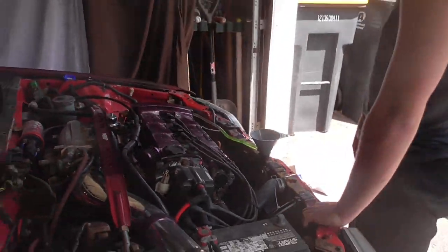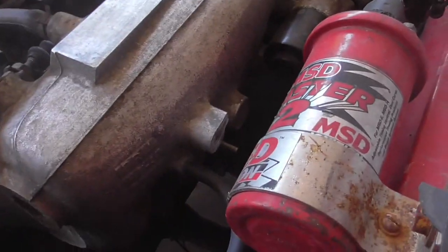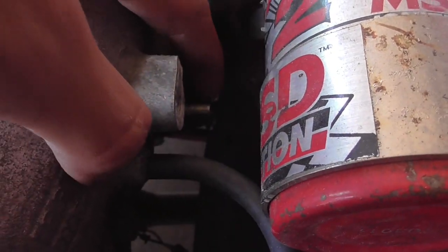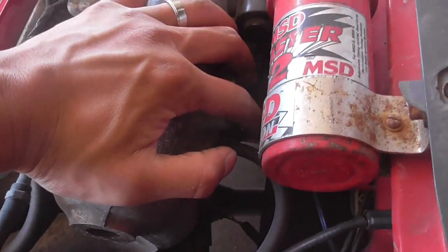We got done bleeding the coolant and it runs slightly better, but it turns out it also has a vacuum leak. It doesn't have that vacuum line right there, so it isn't running perfect. When you start it up it runs really rough because of that missing vacuum hose. If Nate were to start the car right now and I just go and plug it like this, the car would entirely shut off.